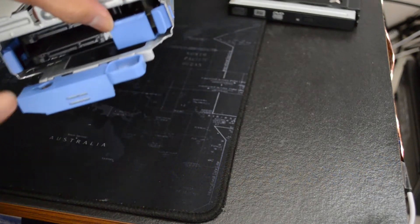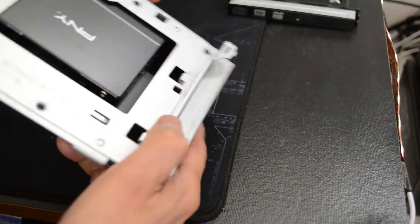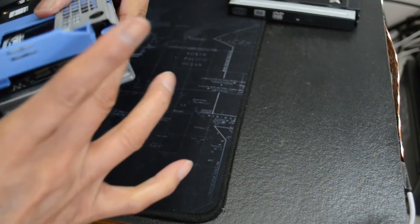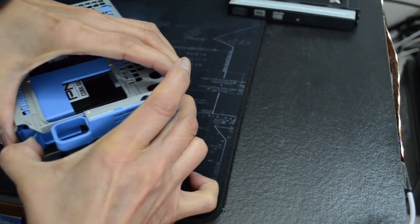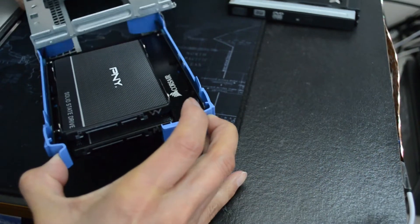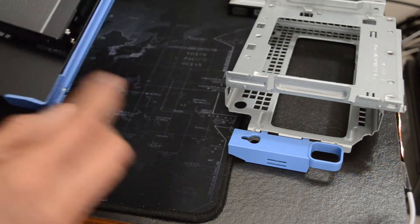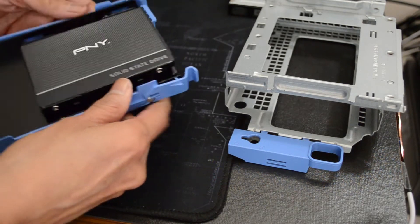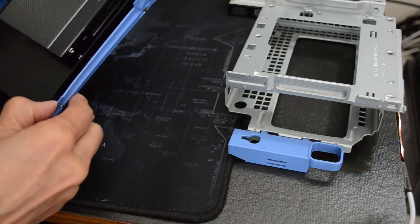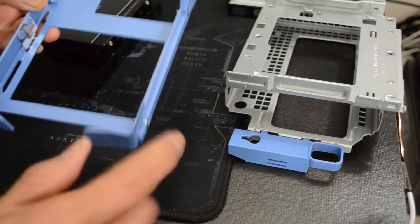So all I'm doing is showing you the casing. This is how it looks when you take it out of your Optiplex 9020. This is the housing. Now what I'm going to do is press these two and slide it out. This one should come out very easily - just hold these two and slide it out. So this is the housing; put it aside for now. Now I'm going to take it out of this second housing. Pull this out a little bit - be gentle because this is plastic and you don't want to break it. Let's put that aside.